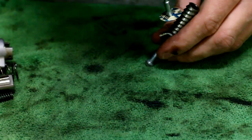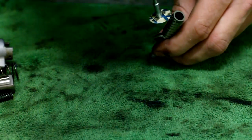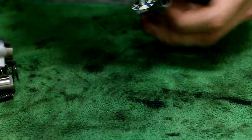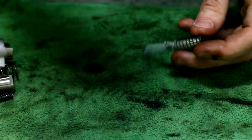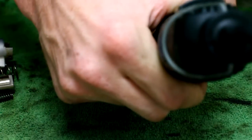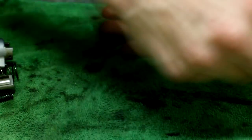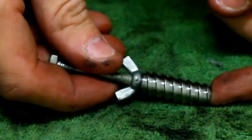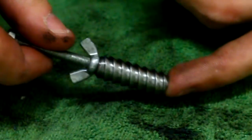Be careful not to stay in one place too long and flat edge it, and try your best not to sand the outside actual lip — you're just going for these topmost surfaces. The edges a little bit shouldn't affect it. This is my second time doing this at 80,000 miles. [Dremel work performed.] And that's it — that should do it. Wipe it off; you don't want any metal debris in your engine. Just rough up this surface, take away that sheen that it will have on it. And then of course you can just pop this bolt back out.